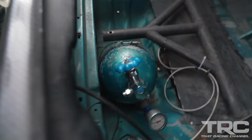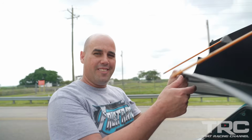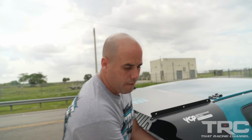Yeah, for sure. All right, so we popped the bottle there? Yeah, nitrous on, just in case. You got the giggle juice. So you use that to spool the turbo on rolls or digs or what? Usually I run it between gears. If it dies out, nitrous kicks in. Also on the rolling anti-lag, if it backs out, nitrous hits right there too. Awesome. So just a little bit of spool help. Yeah, helps a lot.